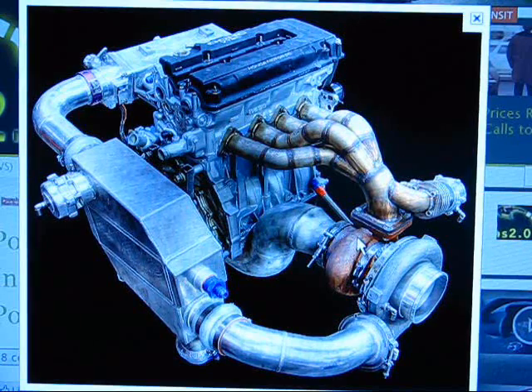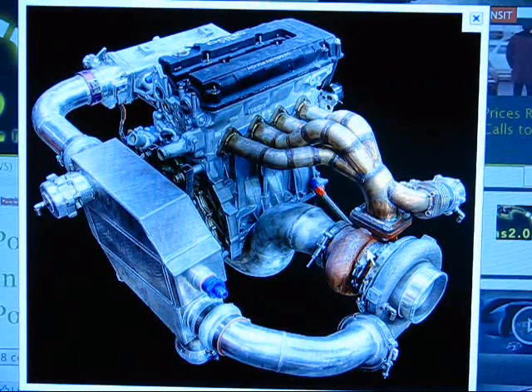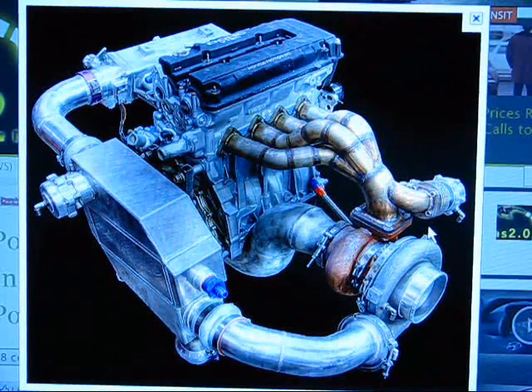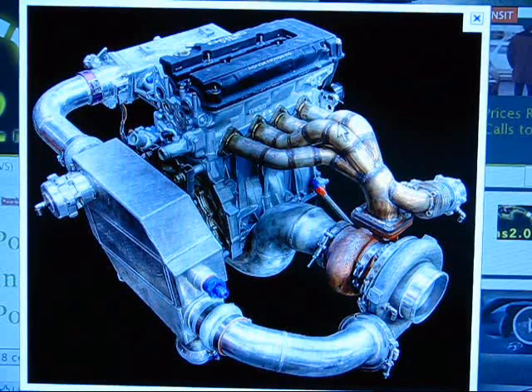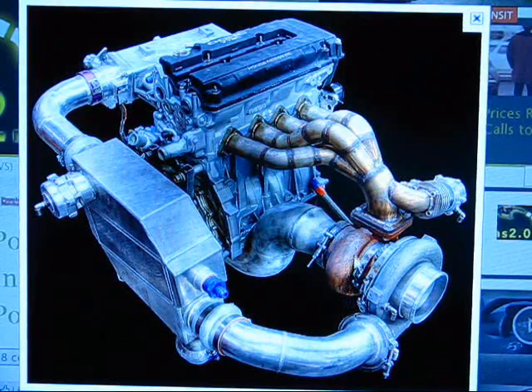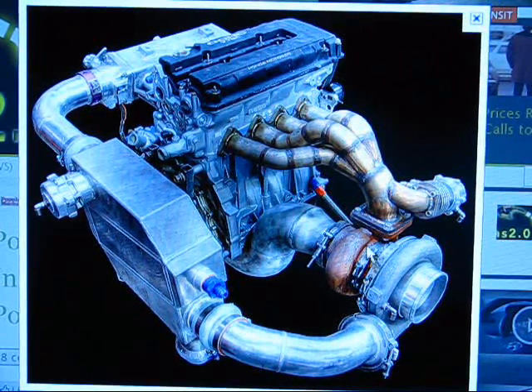In setups using an oil-cooled or float-type bearing turbo, you'll want an oil cooler, because the turbo heats up that oil like crazy and you need to keep temperatures down to avoid damaging other engine parts. Oil can thermally break down and also cook — which is why you hear about people running turbo timers. If your turbo is hot, especially after a few boosted runs before you shut off the engine, it will actually cook the oil still resting inside the turbo.